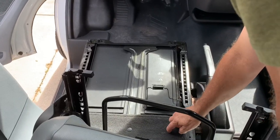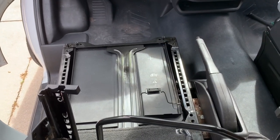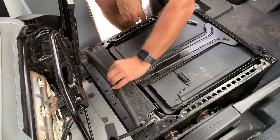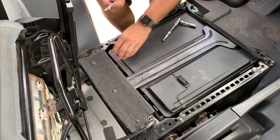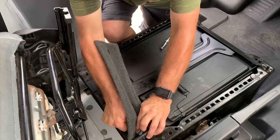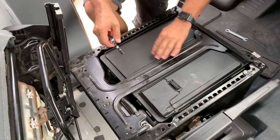I just need to remove these three little plastic clips so I can access this bolt, which lets me take the panel off and see what it looks like under there — and figure out where we can mount the solenoid. I'm removing these clips now so I can get the bolts out. I think there's only two of them, one here and one here. They make tools for this, but a wrench is actually going to work pretty well.